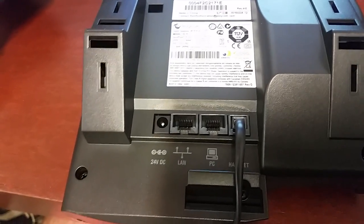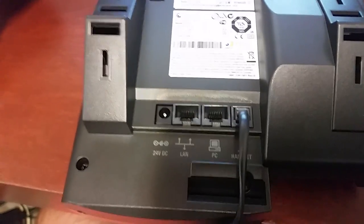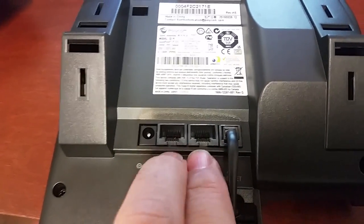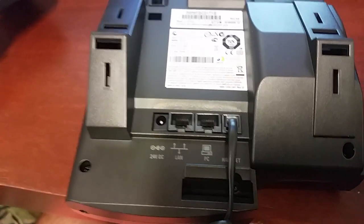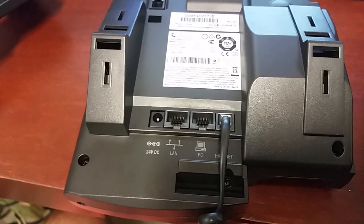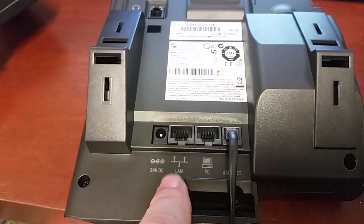That's the reason there's two ports. Do not — and I see this problem frequently because people don't understand — do not take both of these ports and connect them to two wall sockets. First of all, it's not going to make anything work faster or better. And all it might do is end up shorting out your power over Ethernet switch and causing some sparks. You just want one cable from the wall that goes into the LAN spot.